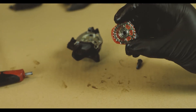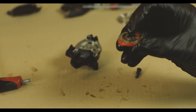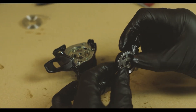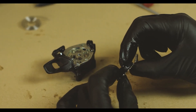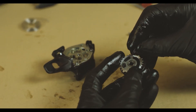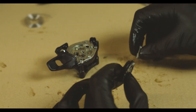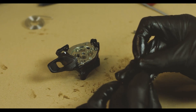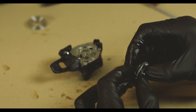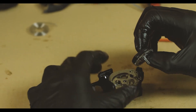Set this aside if you ever want to go back and make your shifter 11-speed again, but this whole unit is going to be removed. Now we're going to take our E13 ratchet and spool and install the washer on the bottom. After a light greasing, everything should stick pretty easily. The washer goes on the ratchet, then the E13 pivot bolt goes into the top of the spool — sort of thread them together, make sure everything's snug, and we can drop this back onto the shifter body.